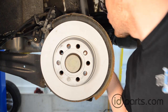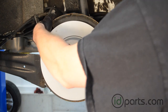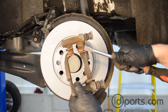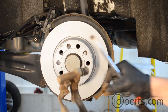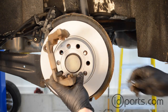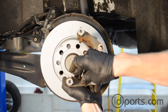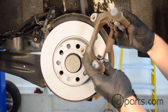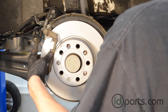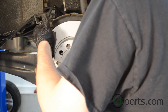We'll take the 14-millimeter triple squares and line them up, placing them inside the back of the axle. We've got a little anti-seize on them to make them easier to remove next time. Before we put the carrier in place, we need to remove the four metal clips — most brake pads come with new clips. We'll use a flathead screwdriver to remove all four and install four new ones. With all four shiny clips in place, we'll line the caliper carrier back onto the rotor and line it up with those two 14-millimeter triple square bolts, hand-threading them in first, then tightening them down using our triple square bit.